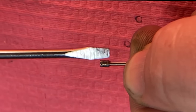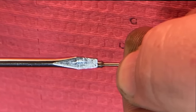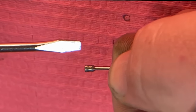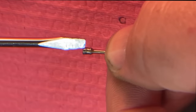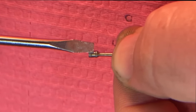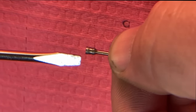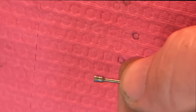And that's exactly the seat. And once it lifts off the seat, this is really just what develops the spray pattern. So that little bitty, I can't tell if it's a hole or what that is, but we'll try and clean that off as well. This one, you can see there are more rings around the spraying portion of the pintle. Of all of them, this one's probably the worst. We'll see what we can do with it.